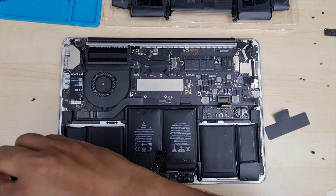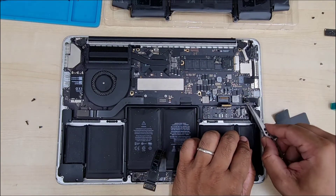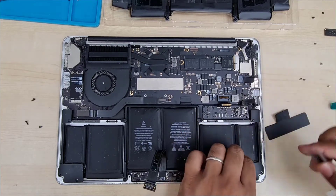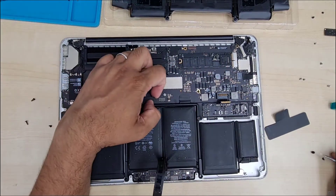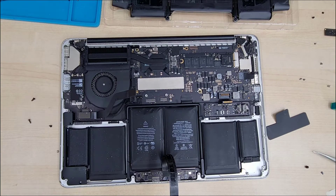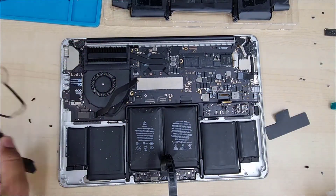The first screw is quite fat. The middle one is long but skinny, and the third one is very short. Try to disconnect the connector with plastic tools, but I use metal because I have control over the pressure — that's fine. Keep the left speaker on the left side and the right one on the right side. The flex cable for the left speaker runs underneath — you can see it runs all the way across. Don't be confused: you have to disconnect this connector before you get to the speaker connector. Just pull it up and it comes right out — pretty simple.